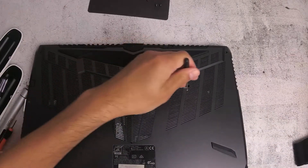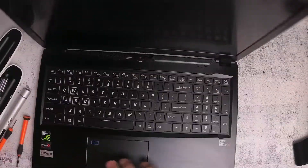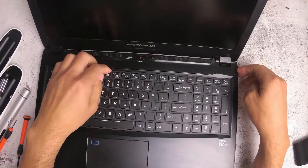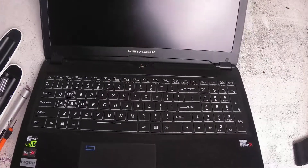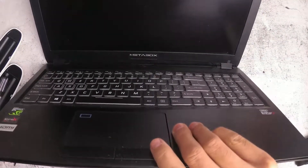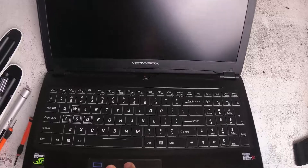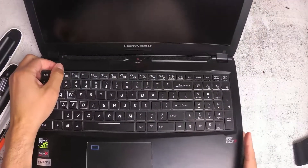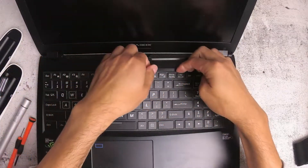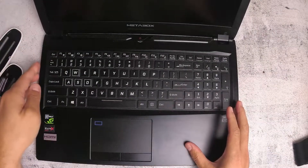Use something to push it so that the keyboard pops out. Flip it over and the keyboard is already popped out a little bit — you can see there's a small gap at the top. If it doesn't pop, use the screwdriver again to just pop it out. There's more of a gap now to pull the keyboard out. Just be gentle, don't use too much force — you'll feel it pop out. Make sure you've got everything removed.